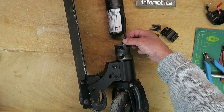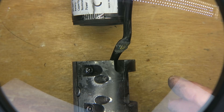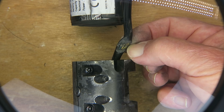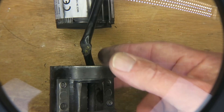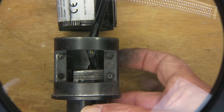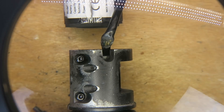This I guess is the connection that goes down to the motor — it can't be very much else — and I can see the copper and the breaks in the wire there. Brought into play my desk magnifier, and hopefully you can clearly see the damage to the wires. We can see the copper inside, and this black soot is clearly smoke damage. This must have been quite entertaining when it went up. That's loose, possibly broken. I have no idea how we get into that, but it appears to go up and down on there, and that drops out the bottom. What the connection is to the motor at this point, I have no idea — I'll investigate that later. Let's pull the rest of the gubbins out of this tube and hopefully see more clearly the rest of the damage.